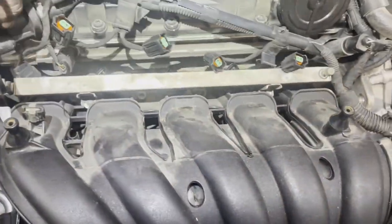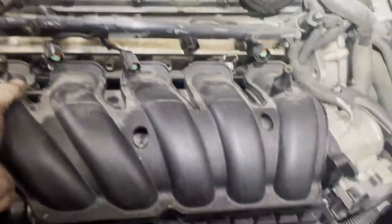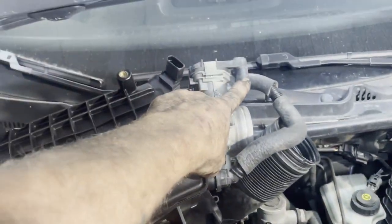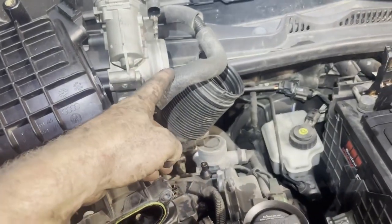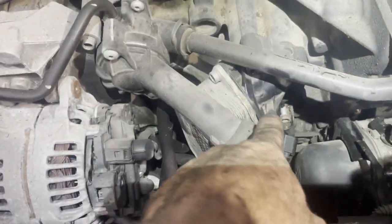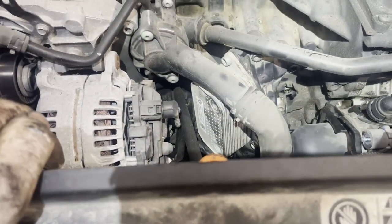Alright, I was able to pull this out of my way and now this intake's about to come out. I got to get everything unplugged. I undid this throttle body plug, snaked that hose right through here, this hose came right out through here, and I just pulled the intake up out of my way. I still got my fuel line on there, but now you can see the oil cooler housing very clearly — it's going to be a lot easier to get to.